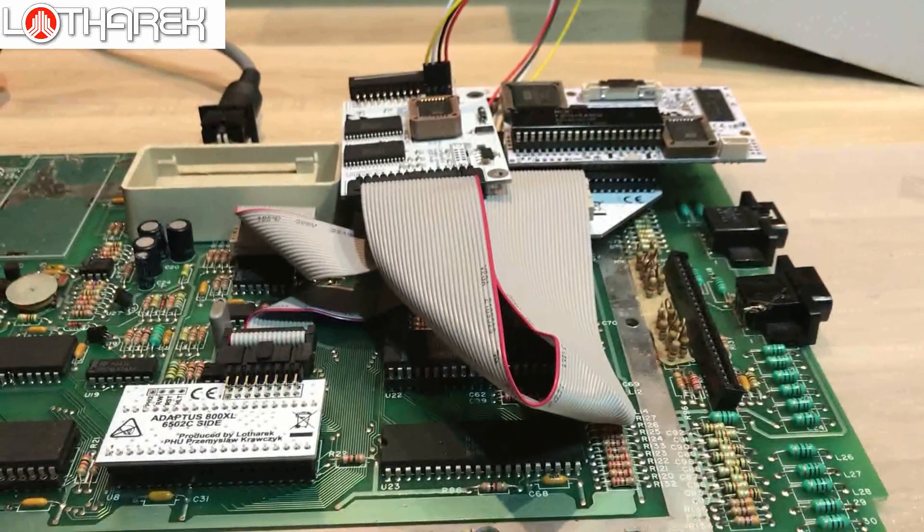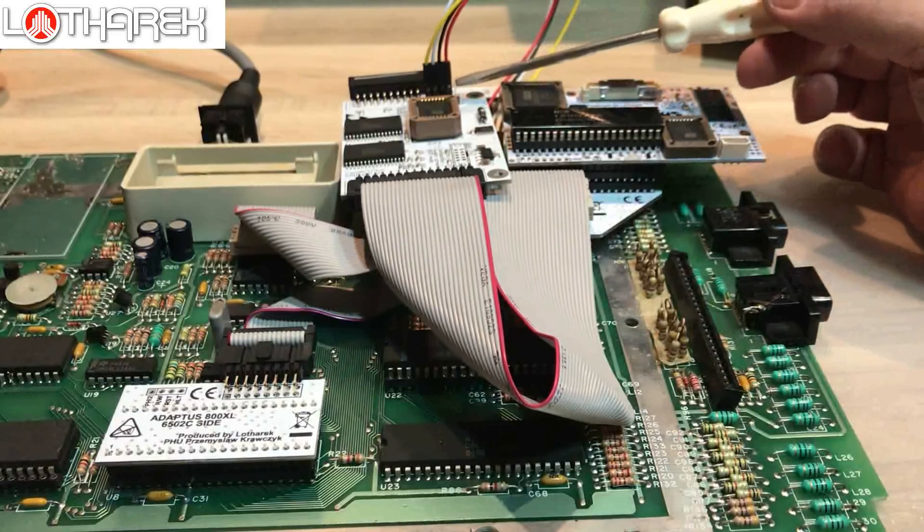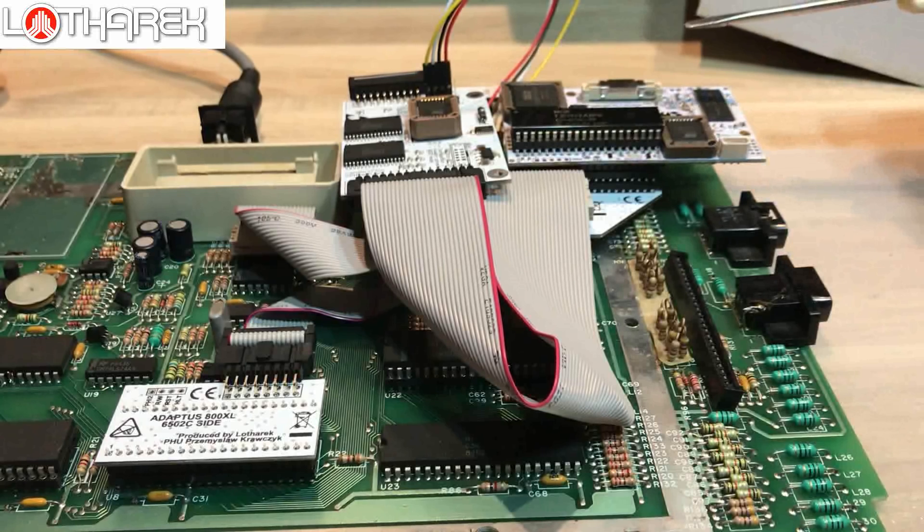One more thing to do is to connect Rapidus with the Atari. Those three signals must be connected with the supplied connector — my manual description explains where those cables shall be connected. Let's get the recently announced new Ultimate firmware: when this pin is connected to the ground of the Rapidus connector, the Ultimate can, via software using its BIOS, disable and enable Rapidus.